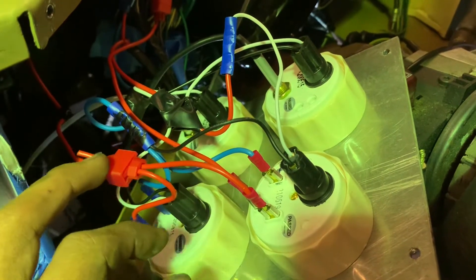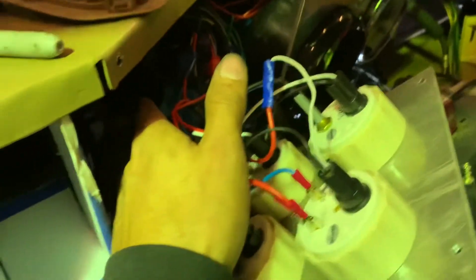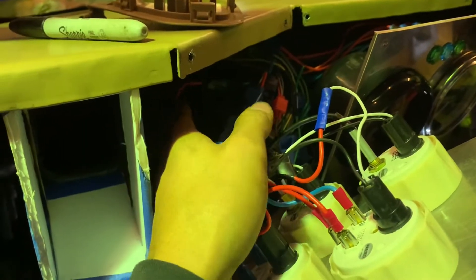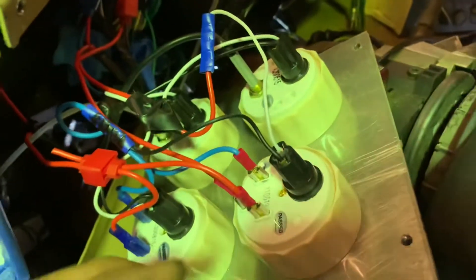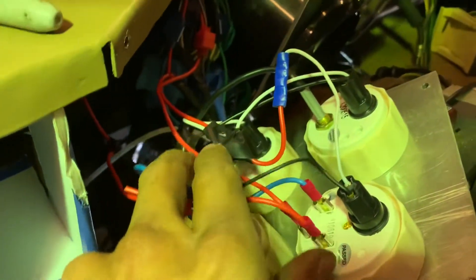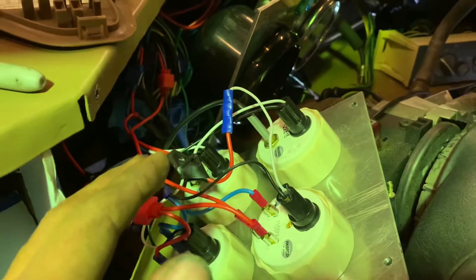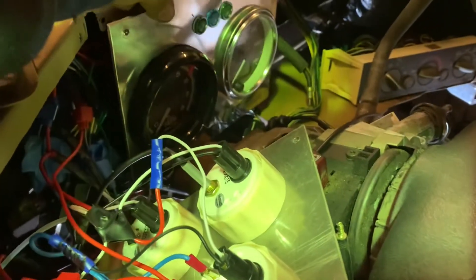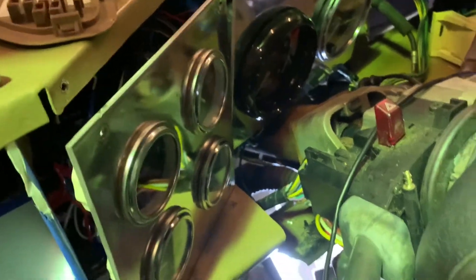The voltmeter is connected to the other gauges like the tach and the speedometer, and it's connected to the pink wire on the factory harness. Then the sending unit — this third wire, the red wire — runs all the way to this splice over here, to the factory purple wire, which is the fuel sending unit signal. There's only one of them on the gauge cluster for fuel, and that's the one you use on the gauge.